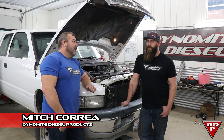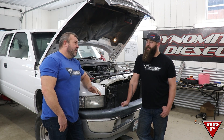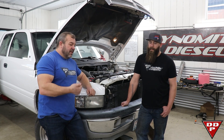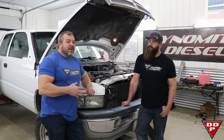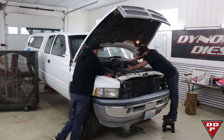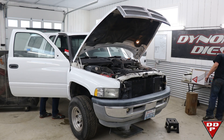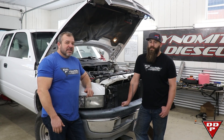So far we've got stage ones in it now. We've advanced timing — 17 degrees-ish right now. And we're back to stock fuel plate and AFC settings. We've checked fuel pressure and put a pressure limit valve in it. I bought this truck from an estate and the lady didn't know a whole lot about it — unfortunately her husband had passed away. All the paint on it led us to believe it was a virtually stock truck, and it drove very stock. As received, it came in at 171 horsepower.